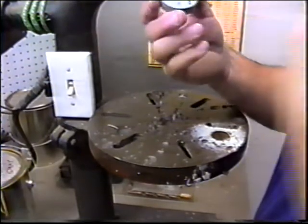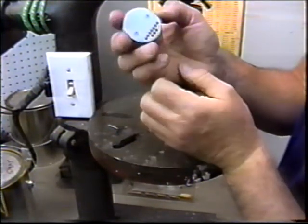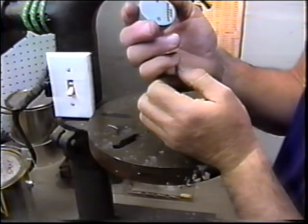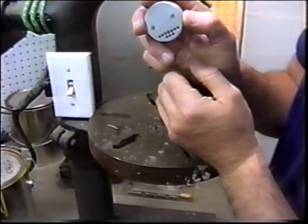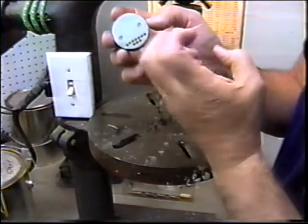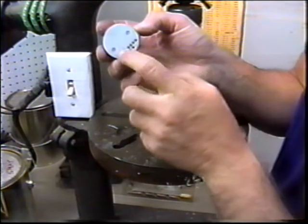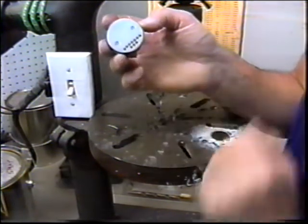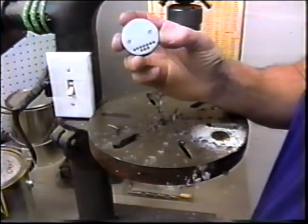And an interesting thing is the Bill Mazzoni muffler with 20 holes seems to be a little on the less back pressure than we need. This one seemed a little more back pressure. So I'm thinking this is 10, the other one is 20. We'll probably wind up with 15 of these holes. And hey, if we don't, we can always fill a couple of them with threads.